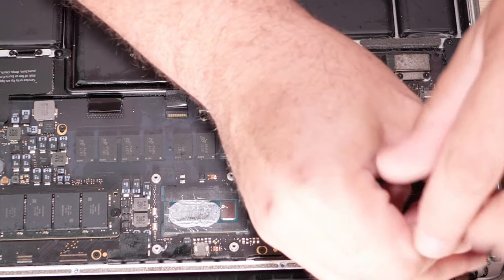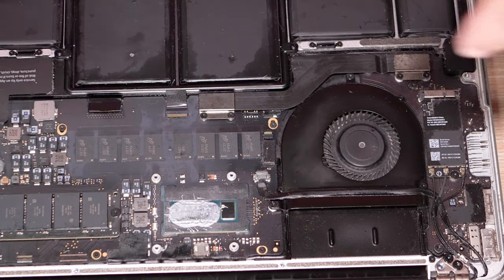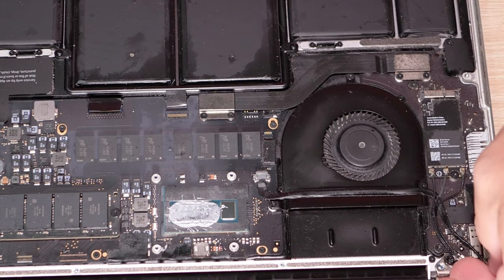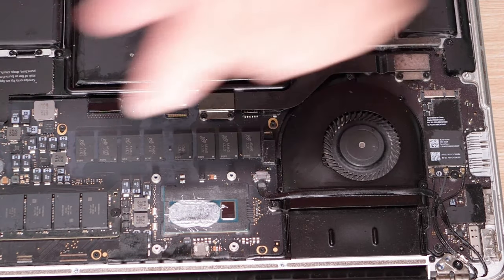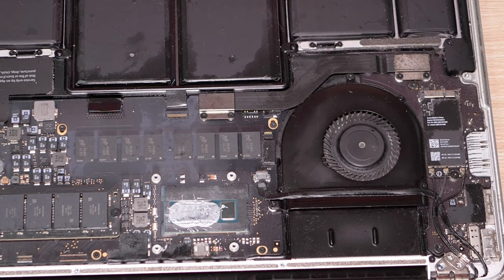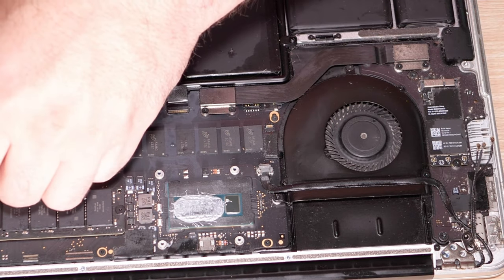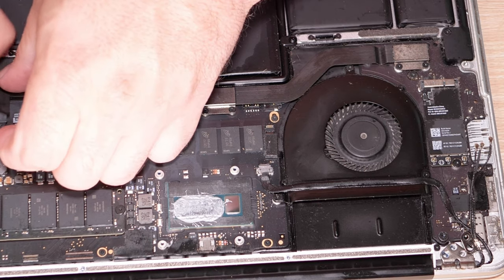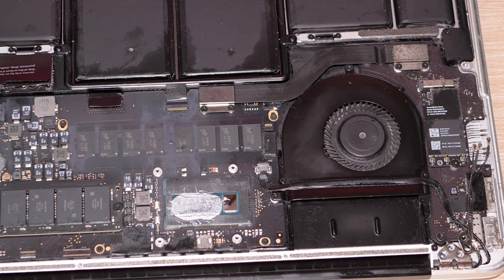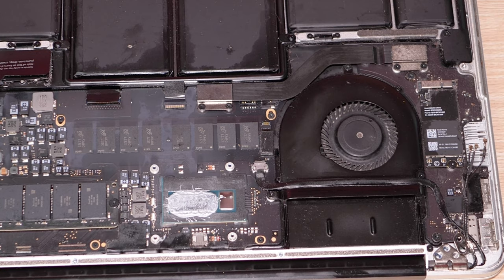There will be some Wi-Fi, the webcam, and the screen. So there should be at least 3 cables coming down. Wi-Fi is fairly obvious. Looks like the webcam may be coming over here. I'm not sure. All right. Okay, so let's go ahead actually before we progress any further and pull the battery terminal so that there's no energy going through this board. So there's no risk of anything getting zapped by an error. All right, let's pull the display cable real quick. That's the only thing on this side, display cable.